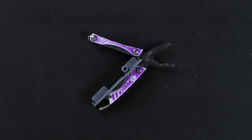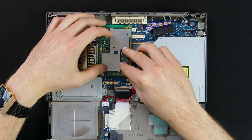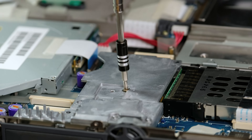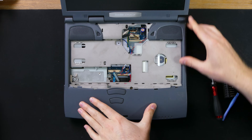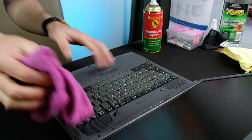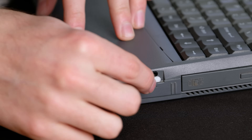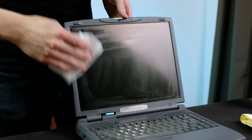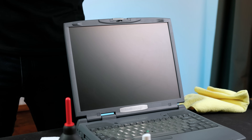I decided to glue the hard disk cover nut back in place — after a few hours it should be nice and strong. It's now time to reassemble the laptop. I love that nearly every component is replaceable and pretty easy to get to; I can't really say the same for a lot of laptops these days. With the top casing, screws, modem, and keyboard reinstalled, I gave it a good clean with a healthy dose of eucalyptus oil. This is starting to look like a much cleaner laptop. The screen was also quite dirty — a damp paper towel followed by a microfiber cloth and some lens cleaner got it looking a whole lot better.